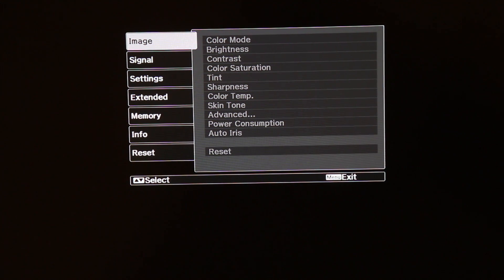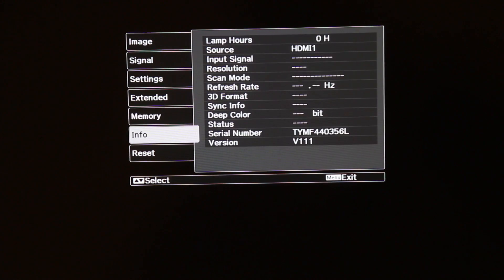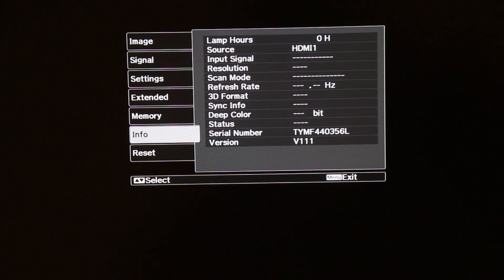The projector is powering up now — in fact, it's powered up. So I'm going to hit the main menu button. I have no source plugged in, and there's our main menus. All I have to do is scroll down to info, and there we go. The last item is version number, and now it says V111. The original version was V110. The next step will be to do a side-by-side comparison — I'll be shooting some video and stills to show you the improvements that the new firmware makes by adding detail enhancement. Thank you.